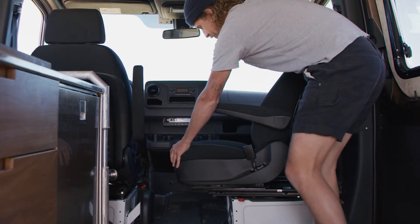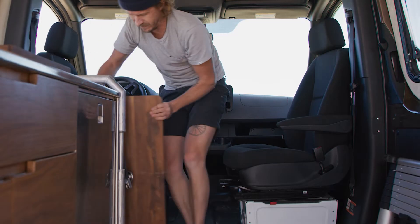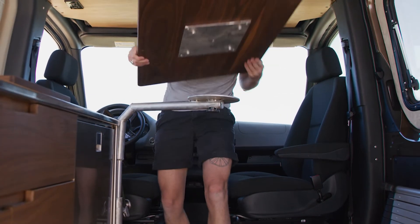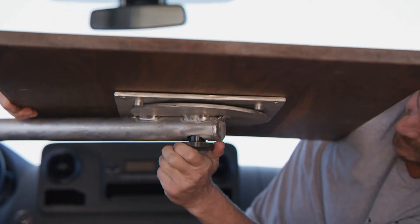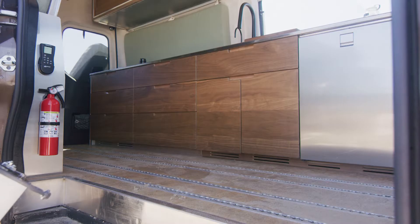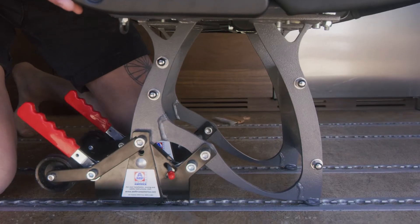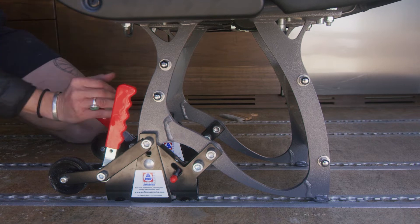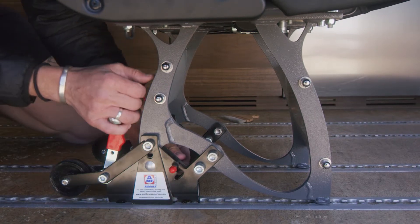The front seats swivel into a dining area. Pull the red latch first to turn the seat, then slide the seat back to make more legroom. Remove the tabletop from between the driver's seat and the fridge, swivel the table base from behind the seat, and attach the tabletop to the base. Move the table between the seats to create a seating area perfect for working or eating. The Switchback is also equipped with an L-Track utility system used to install additional seats. Slide the front tooth into the track and set down; once seated, flip the red handle up to lock the seat in place. To remove, lift the locking device in front of the handle and then pull the handle back.